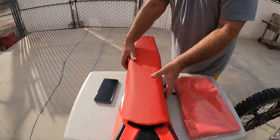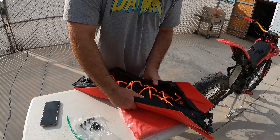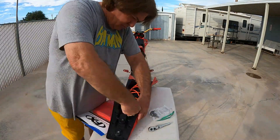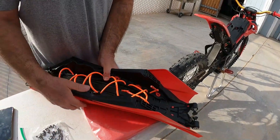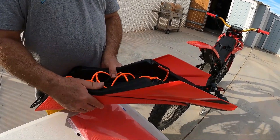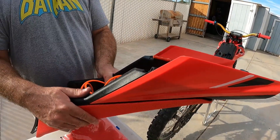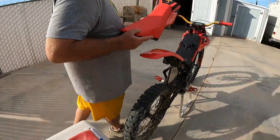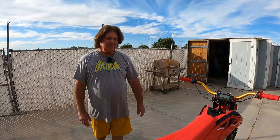This is just a good gripper so you won't slip around. You just set it right back here and start attaching your screws — you might have to squeeze a little bit. Put the screws in and don't torque them down really hard, just firm not hard, because they're going into plastic. This doesn't have an engine so there's not a lot of vibration on an electric bike, so they're not very likely to ever loosen up. Then when you're done you just put it back in like normal and put your bolt back through.